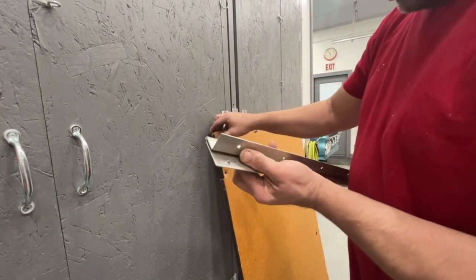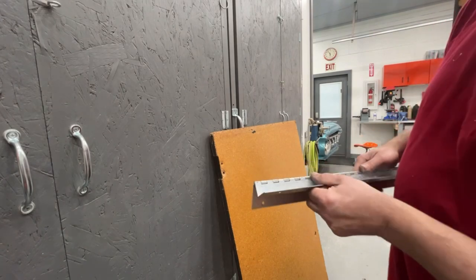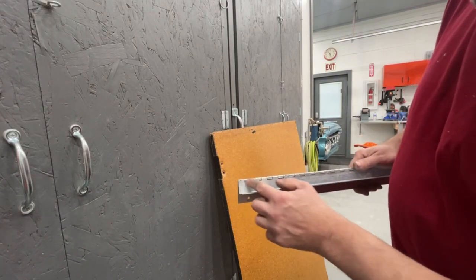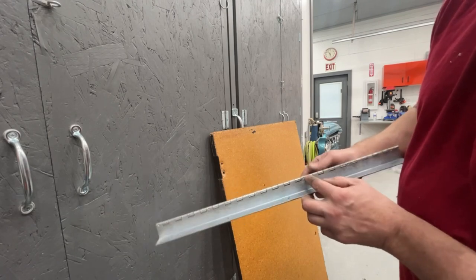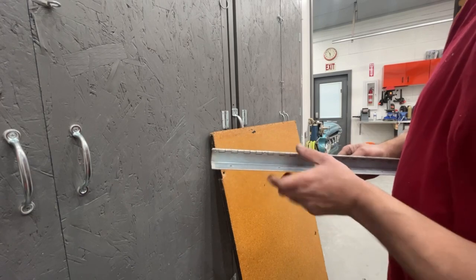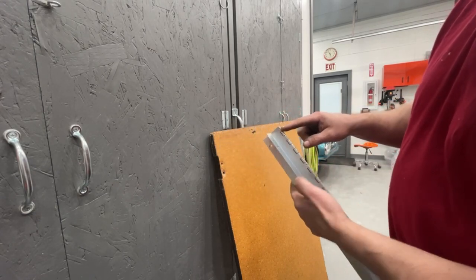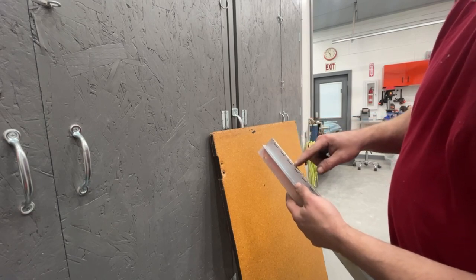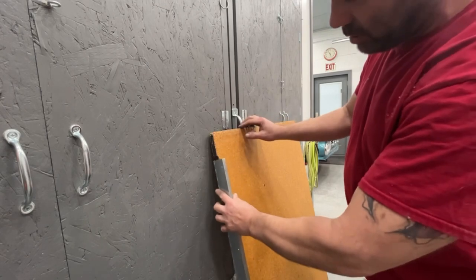And this is, for the most part, a pretty sealed hinge. They have little indentations in the metal. And what those little indentations are doing is holding that pin from wanting to slide out of this hinge. So, as long as I have that little indentation, and then I cut it, you know, whatever height I need, I should be fine. I'm gonna have to drill a hole.